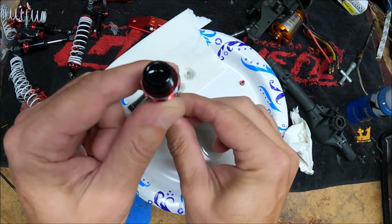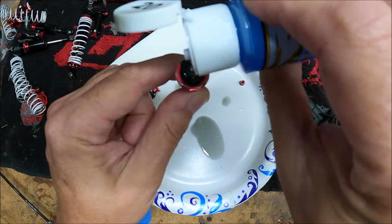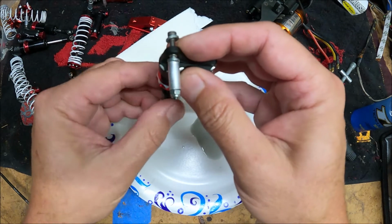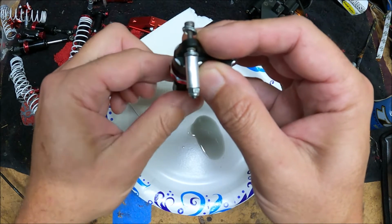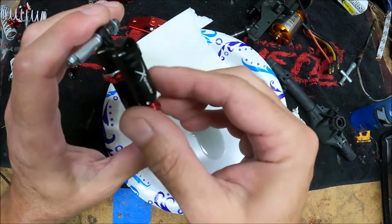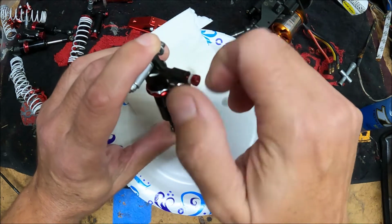And then before you put the cap on, you need to push the shock piston to the top. And then this one has a bleeder on it. That's this red piece that we took out. Let's put this back on. And I'm about 90% to the top. And then push it the rest of the way. And you'll see some should come out of this hole here. Just a little air bubble came out, so we filled it. Perfect. And then put the bleeder screw back in.